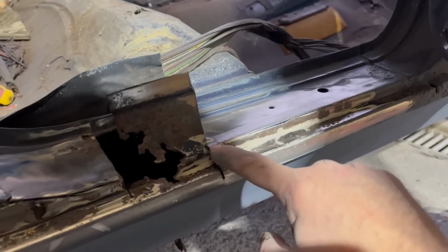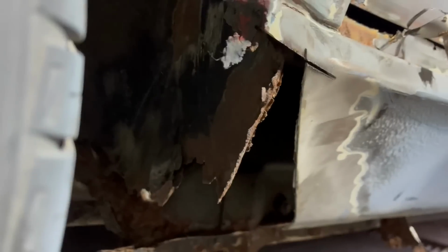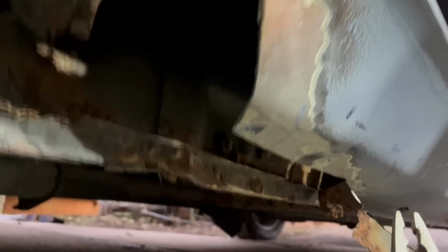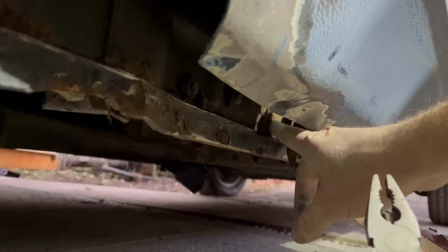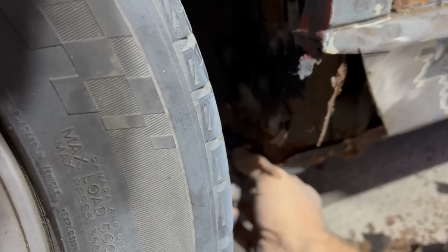So really, I need to cut along there, all the way under the B pillar and replace that whole section all the way through. All of that is fine. And then underneath we have, obviously the rear end is now missing because it's gone, and a slot along there that needs to be repaired. So inner sill wise is actually really good. Normal repair to the back end, but that's, you know, normal on these and to be expected.